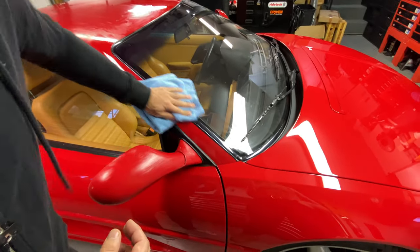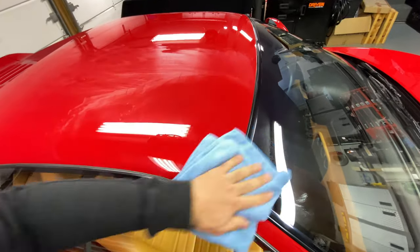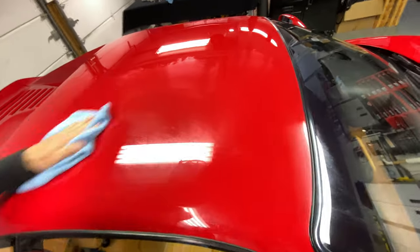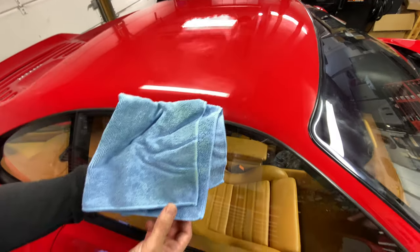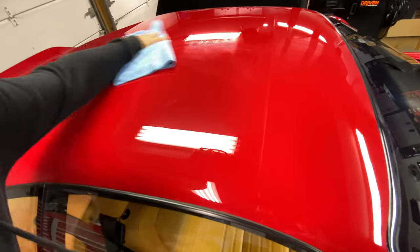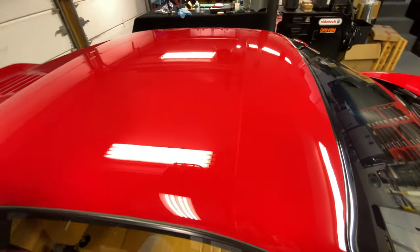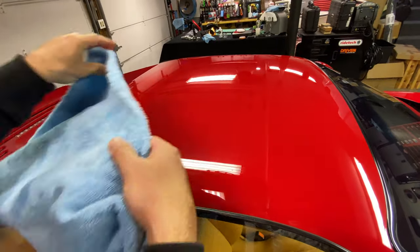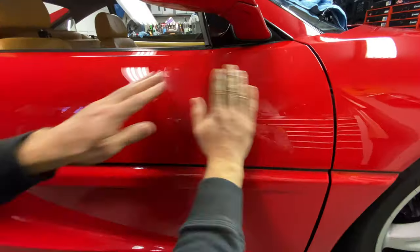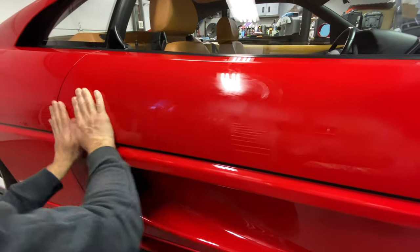Cars painted by robots put down the bare minimum of paint to save money — especially Ford. When I miked the entire paint on the GT350R, there were spots reading 2.5 to 3 mils on a brand new car, which is unbelievable. Whatever gets on the glass I'll go over with foaming glass cleaner. What's great about the Zymol is you don't get that chalky residue issue in all the old weatherstripping. Can't wait to pull the car out of the garage to show the final results.